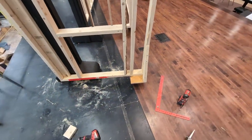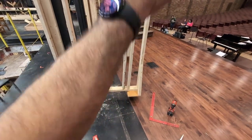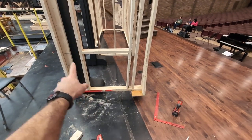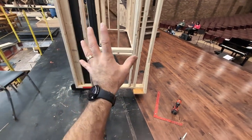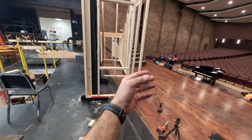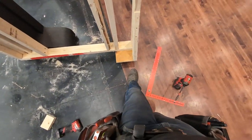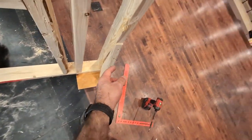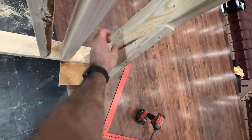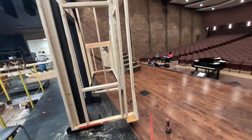Man, I'd really like to. I'll take that gusset off and trace him, but before I put the tube back on, we'll use most of a full sheet here. That way I've got all this registration underneath the window hole to help hold this square, and then it won't hurt to put those back on. In fact, I can take another 1/4 inch off the face of them like I did before, just to keep this corner down here. It's actually a little bit proud right now. So I could take a little, like 5/16 or almost 3/8 off of this surface of these when I make another one, and then I put the Luan on this whole wall and then put those gussets back.